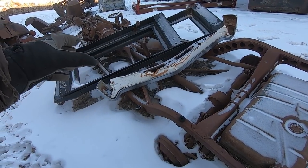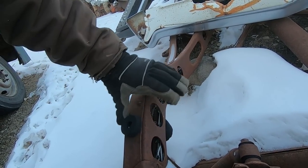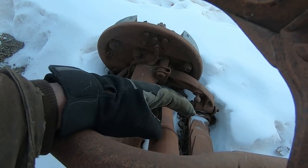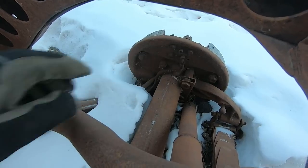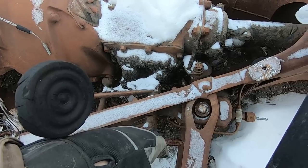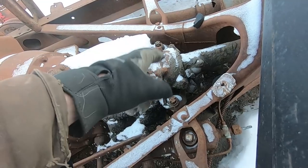This is a 42 frame. I'm not really familiar with these, but 42 to 48 are all pretty similar near as I can tell. The nice thing about these is the way the cross member comes in and the way they're boxed — it's way on the outside here. So the dirt isn't pinched tight against the outside rail and they don't rot out as bad. You do find tube shocks on these, and occasionally on the early ones as well — I believe these are add-on tube shocks, so that's something to look for. They still have the spring mounted behind the axle but the spring mounts are cast into the ends of the axle housings, and then the wishbone bolts to the front. There are our hydraulic pedals — your brake pedal and your clutch pedal, tied right into your transmission. It's got the same reservoir or master cylinder basically from 39 to 48, just a single reservoir cast iron cylinder. One other thing to note is if you have a speedometer gear on your enclosed drive shaft, it should say the gear count on it, and that'll tell you what gear ratio they have.